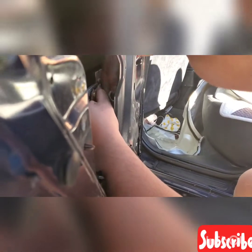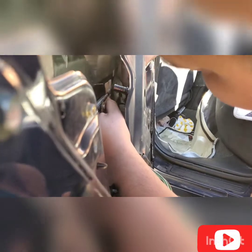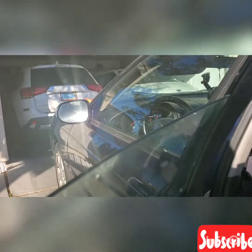Another person is supposed to hold the window glass while the other one sets the bolt in place. I suggest it's easy to do with two persons, but if you don't have anyone able to help you out, all you need to do is put masking tape through the window frame, and you are able to do it by yourself.